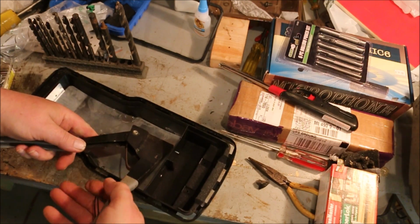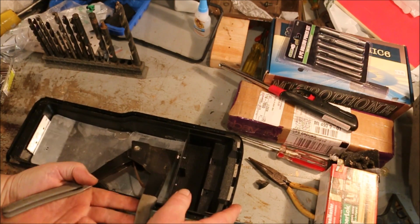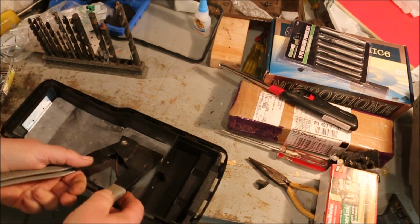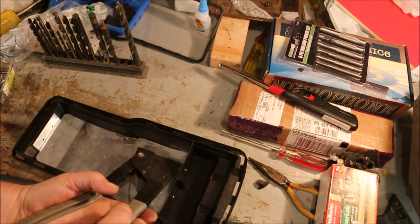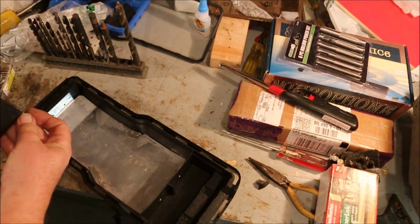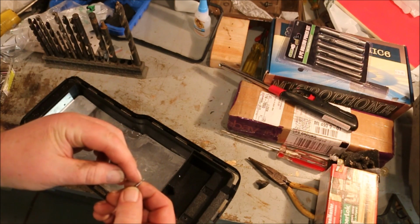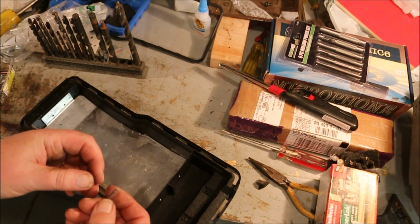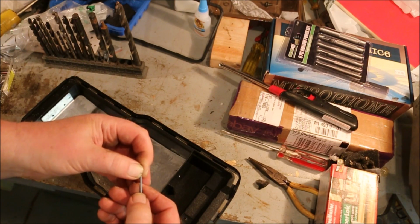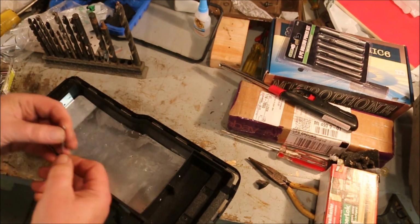You can see the head being pulled into the tube, and the tube expanding. Then the head comes down against the end of their pliers here, and it breaks it off. There's a little weak spot there where the metal has been pinched. And you can see where the gripping jaws of the riveter have grabbed a hold of that rod and pulled it through the rivet.